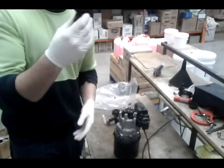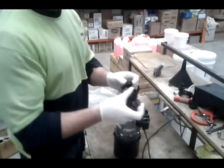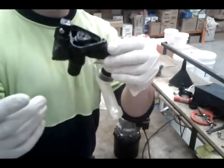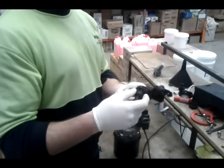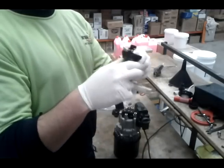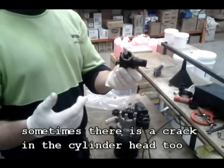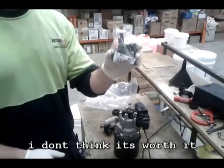Also, before you go pulling all this apart, you should also check all of your little connections here, because if you're leaking from one of these seals, like this seal here, it's going to be losing pressure and it's going to be doing the exact same thing, pulsating. So check your seals there, and also your other seals that go here. If they're not leaking, it comes down to the control head, and that's this thing here. Cylinder control. And you can pull it apart, clean it. I tried mine, doesn't work. I'm going to replace it, and that'll fix my pulsating.